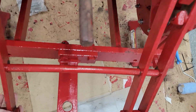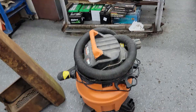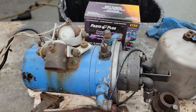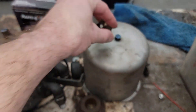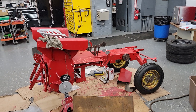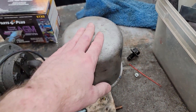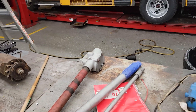We finally got the three-point hitch freed up - it was completely seized. There's a hydraulic piston that mounts underneath which we're rebuilding with two new seals. Here's the original hydraulic pump from the tractor that actually had a hole in it. Parts are impossible to find for this machine. I found out there were maybe 150 of these tractors built in 1971, so it's a bit of a rarity. We had to repair the reservoir to see if it works.